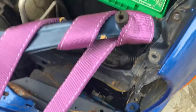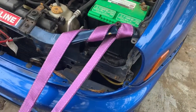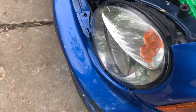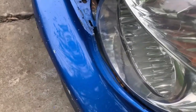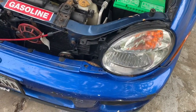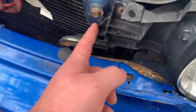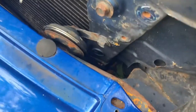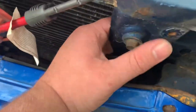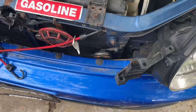I think maybe if I pound it with a hammer or something it'll help. I'm gonna see how my headlight looks on there and go from there. It's looking a lot better — I got it to close the gap a bit, but I'm still not satisfied, so I'm going for round two with the come-along. This whole piece here is bent and I think I need to bend it back so my headlight sits flush.